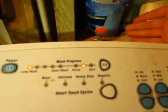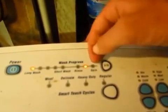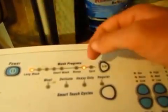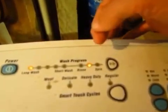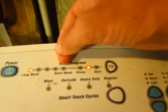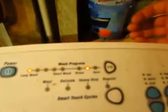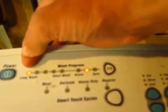So to decipher that binary code into a normal numerical number, basically you go from right to left and you start with 1 and keep doubling that value as you go across. So this light means 1, this light is 2, this light is 4, this light is 8, 16, 32, 64, 128. So only the number 2 light and the number 128 light are illuminated. So 128 plus 2 is 130. So that's how you get the 130 error code off these lights that are on.